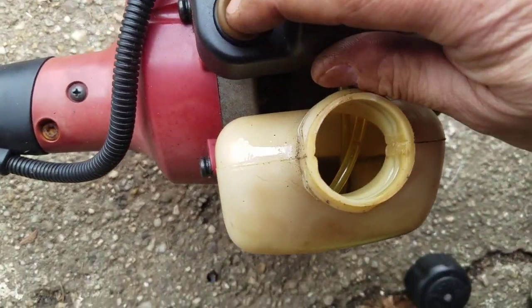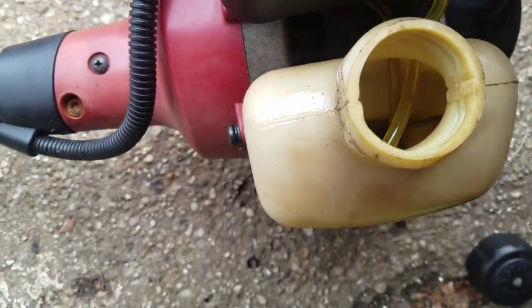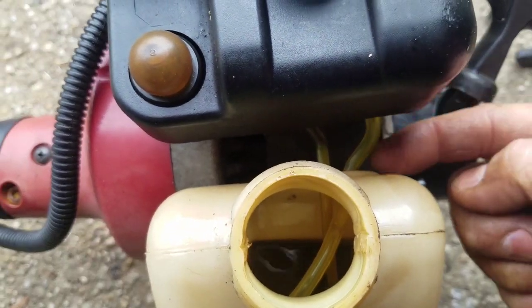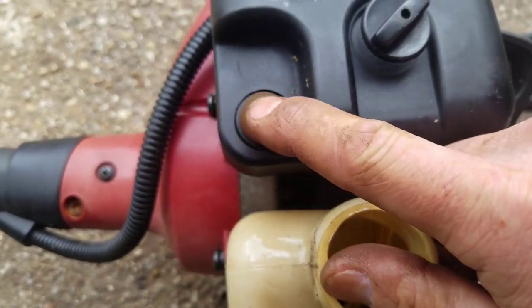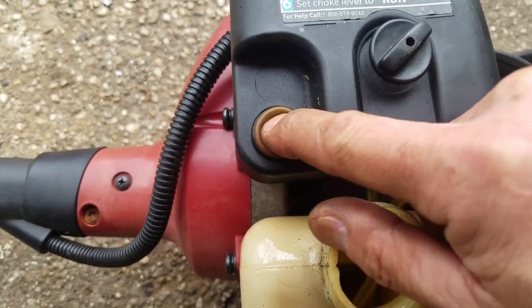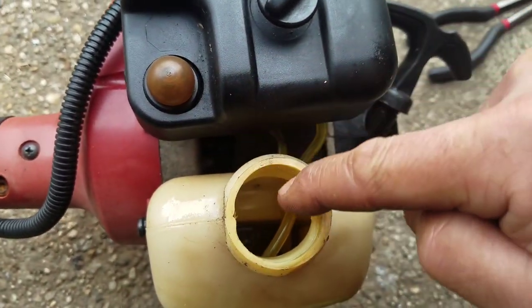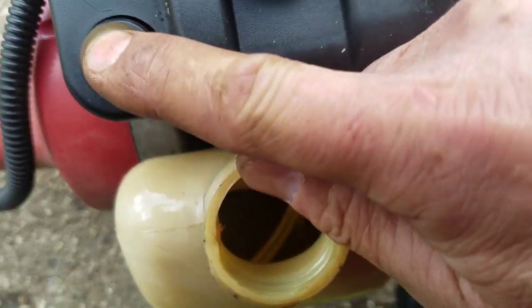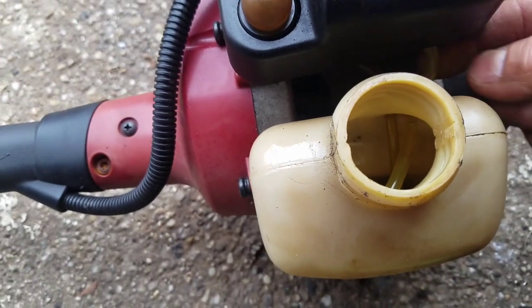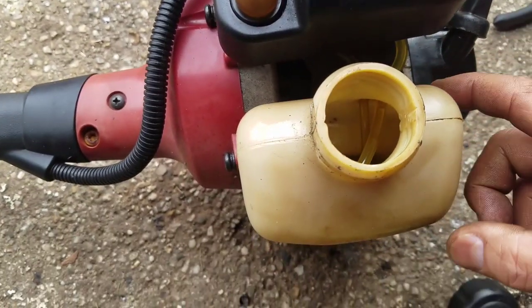When I push it, there's air, right? However, here's the fuel line. No fuel is getting sucked in. And this is always empty. Sometimes you see fuel that's in here with bubbles and stuff. So it pushes, retracts. Air does go through this hose in there because you see bubbles in the water. The gas, you hear the noise. However, no gas is being sucked up into the carburetor.